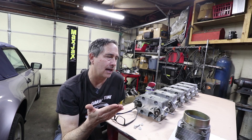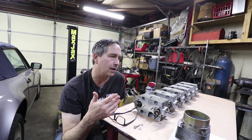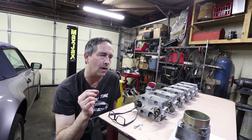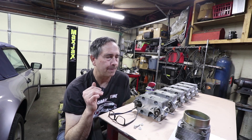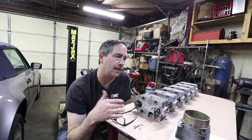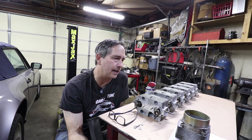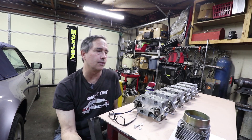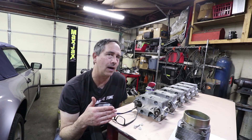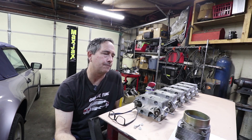Alucil is a little less desirable in that it can't really be reworked or re-ringed. I think it requires a certain chrome-based ring material that is no longer available, so putting standard rings in alucil pistons is a no-go — though some people have had luck with it. I'm not going to change the rings; I'm going to run this engine until it needs rings, which could be a really long time. Let's measure and at least have some notes about the engine prior to going down the road again.